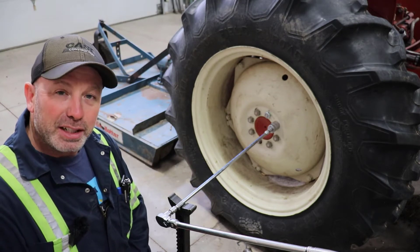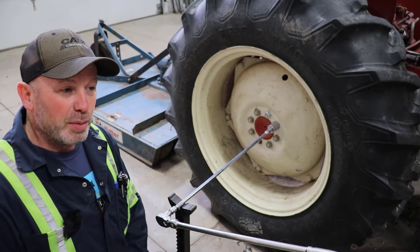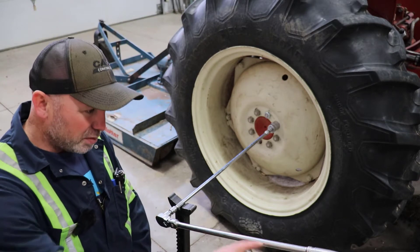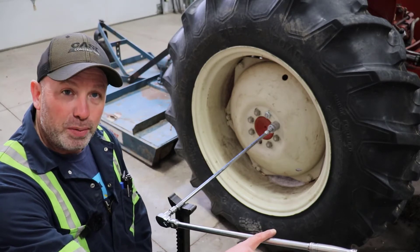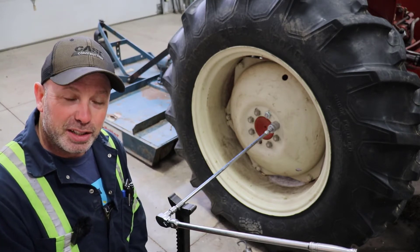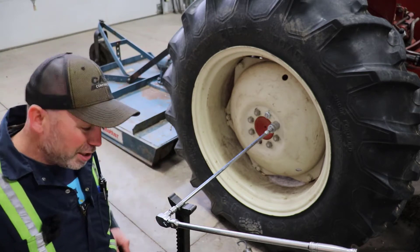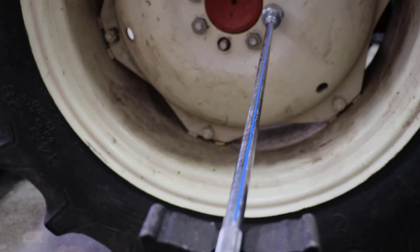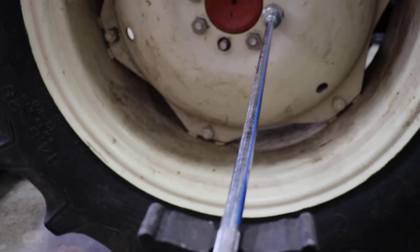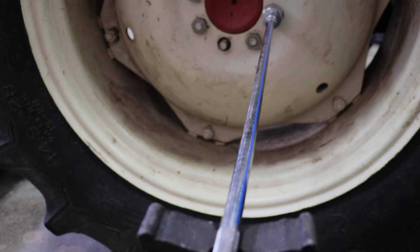I've got my crankshaft hooked to the wheel of my tractor, and the wheel represents resistance. We're looking at a tiny snippet in time — the wheel doesn't turn. The ratchet is my crank throw, and my arm is going to simulate the combustion process. So I'm going to push down on the throw simulating accelerating the crankshaft, and you can see the crankshaft twists — starting here I have a helix going up to straight, while the other end stays at its normal position.